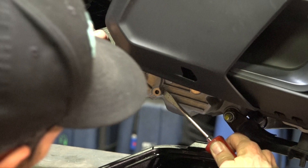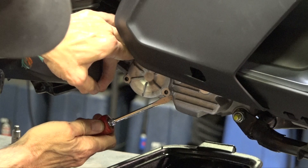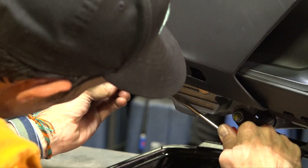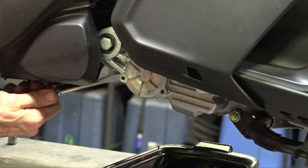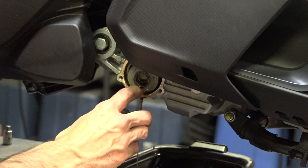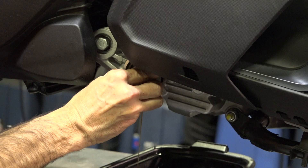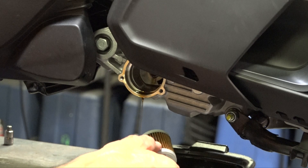Give the cover a little twist to lever it off — you can use two flat-blade screwdrivers. You can see it draining oil from the cavity as it comes free. Make sure you don't lose the spring. Pull the spring out before pulling the filter, then pull the small cartridge filter right out — use needle-nose pliers if needed. Dispose of the old filter correctly. Take a clean rag — blue shop towels work well — and wipe the inside of the cavity out, making sure there's no debris.